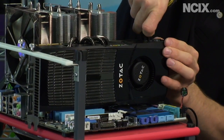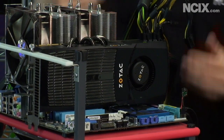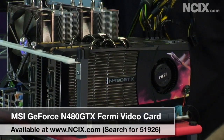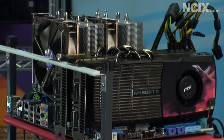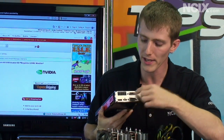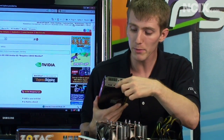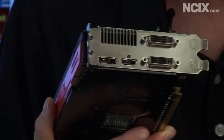I'll install the two power connectors to ensure the card will actually run. This is a pretty simple guide if you've built a PC before — it's meant more as a recipe for all the ingredients you'll need on the hardware side. With ATI's solution, you can see on the back of their video card they have two DVI ports, one HDMI port, and one DisplayPort port. DVI and HDMI all run off the same signal within the card, and DisplayPort runs off a completely different one. So in order to run three monitors, you can only plug two into DVI and HDMI — that's why the third one has to run off DisplayPort.